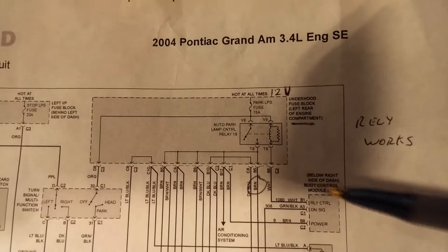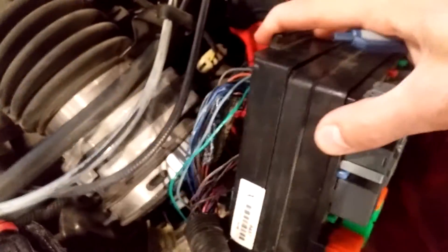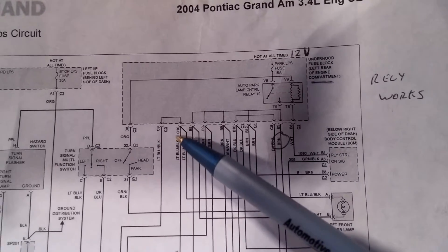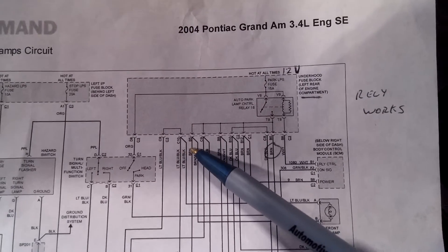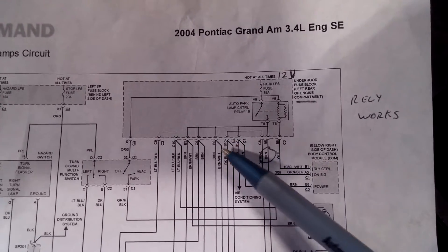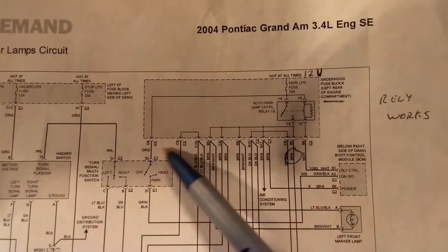However, what they decided to do was to turn this fuse and relay box upside down. So I flipped it over and we got access to all of these wires, and we placed an amp clamp around one of these wires. They'll do this one at a time — place an amp clamp around each wire and then monitor the current on the lab scope while they turn on the circuit. And when they hear this circuit breaker click, they're watching for which wire has a lot of current going through it. So they've gone all the way through these wires and ended up with this one right here — the amp clamp is around that brown wire.